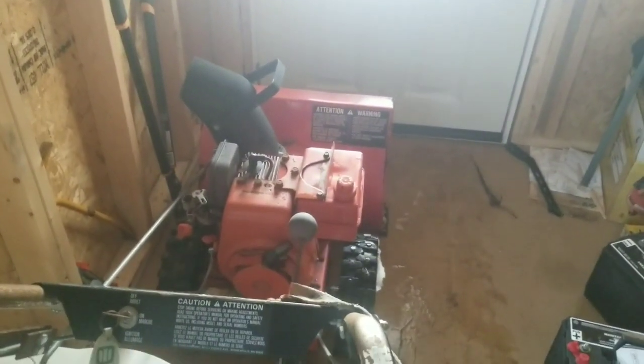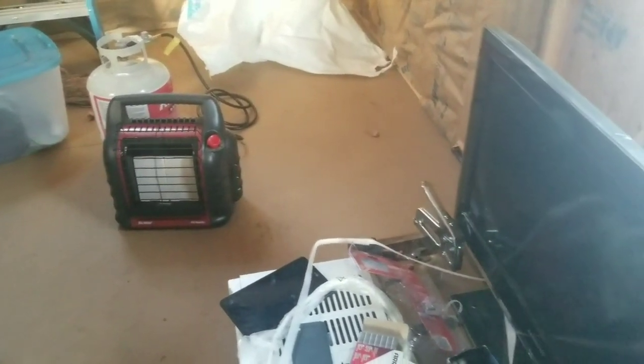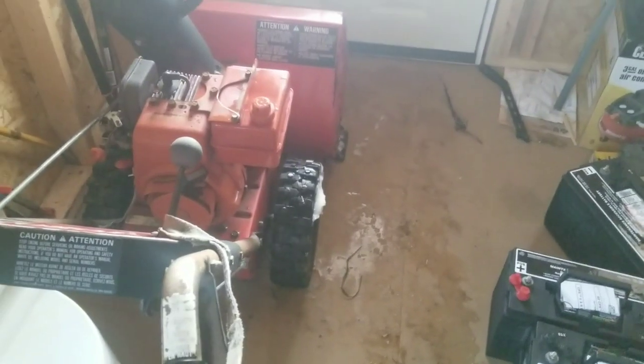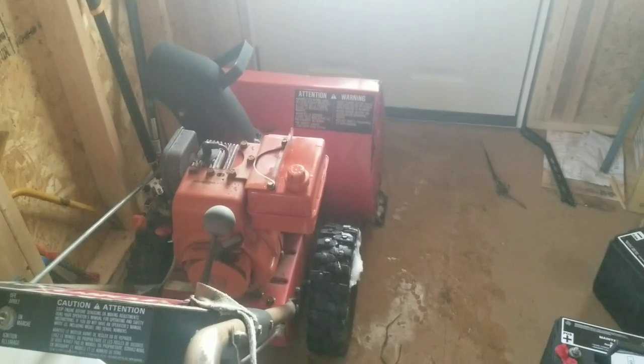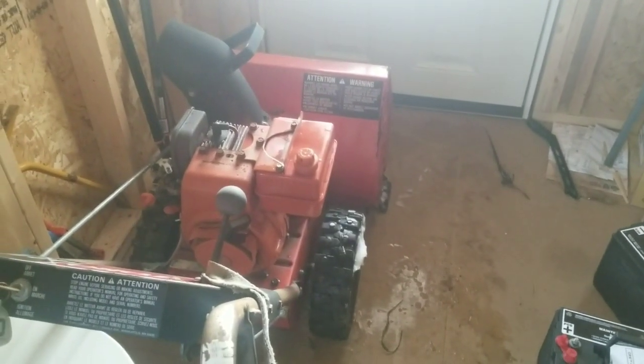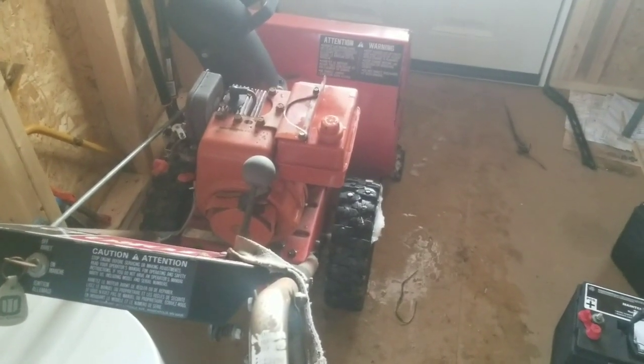Yeah, I didn't get the snowblower running even after I brought it inside to try to warm it up a little bit with the buddy heater. That was going flat out at times. Just so cold in here with just the floor sheathing between my feet and the outside air. Still couldn't get the snowblower to start on anything but starting fluid spray. So it's either take the carb apart and clean it up, or get a bigger one, which I need. I'm thinking lawn tractor and the snowblower.